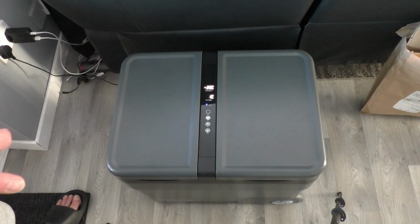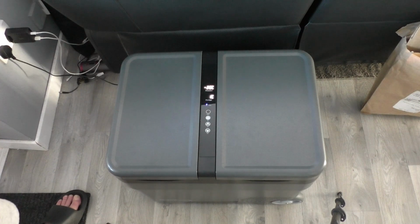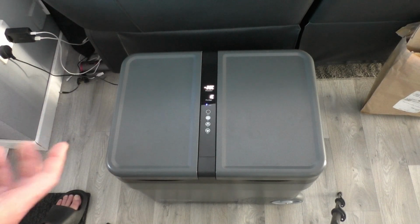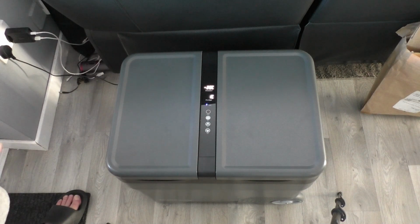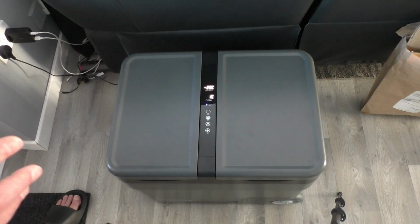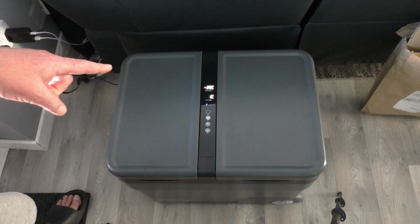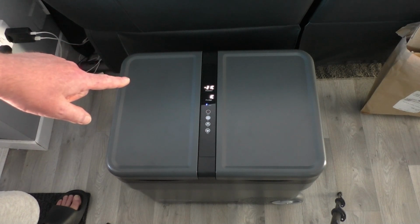The date is the 24th of the 5th, 2023. And the temperatures outside are really warm, and because the glass conservatory magnifies the heat, this unit was struggling to draw the air in through the air vent, through the compressor, and maintain a good cooling temperature because of the power it needed to try and do that. So I brought it further into the house. This part of the home is fairly cool, and within minutes it finally went to -20, and I've now set this to 1 degree.